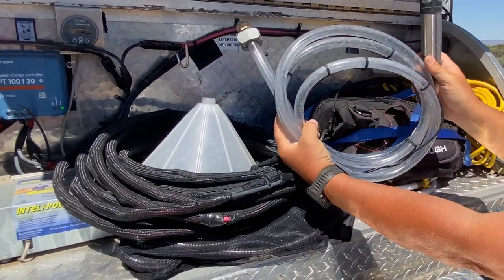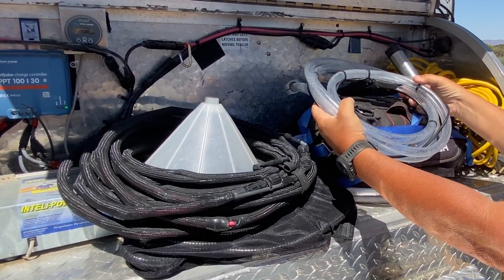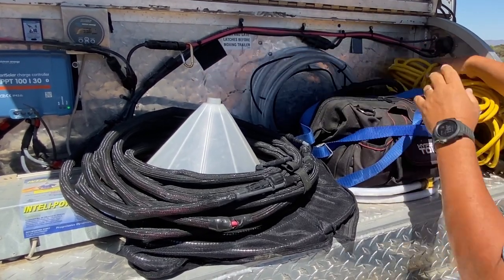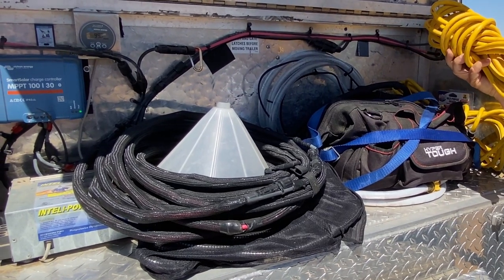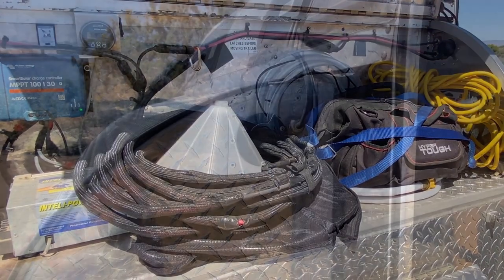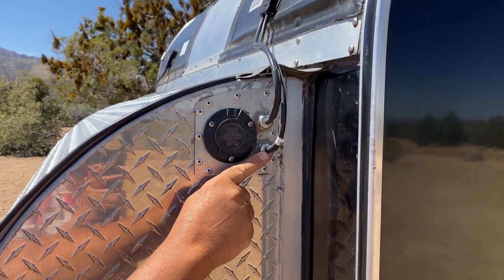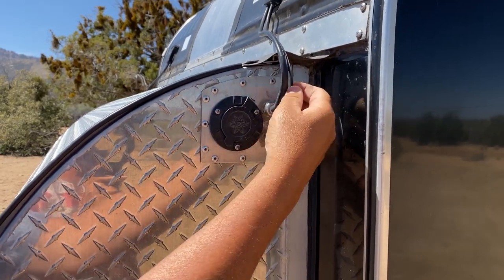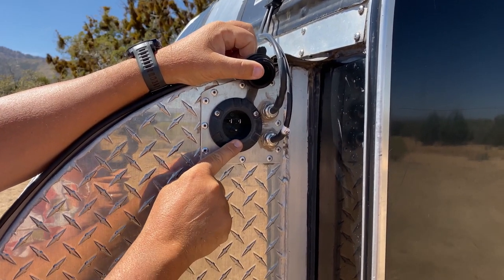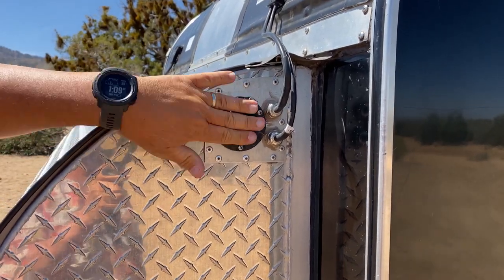We have a water hose and a 12 volt sump pump that we use to fill the trailer water tank from a bucket of water, or if we can't get close to a spigot. I also carry 2 electric extension cords. Our solar panels plug in through watertight fittings that the wires go through. Here is our charge port for our 120 volt power source if we're on shore power. We haven't needed shore power in a long time.